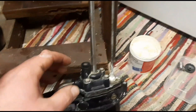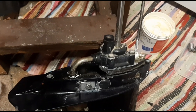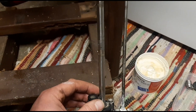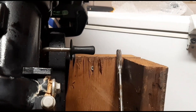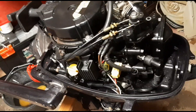Time to get this back on - this is the tricky bit because everything needs to be aligned. I've only got 3% battery left so I probably won't cover it in detail, but essentially all three tubes need to align: the gear lever needs to go back into its bracket through the pin inside the shaft, the water pipe needs to align into the pump housing, and the drive shaft needs to be realigned at the top - you can do that by getting it into contact and then turning the prop.